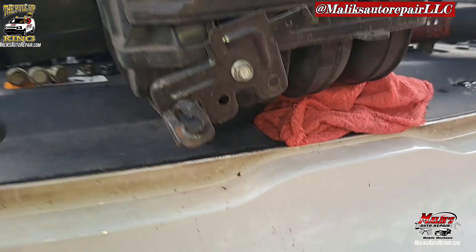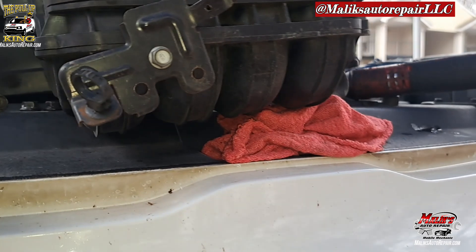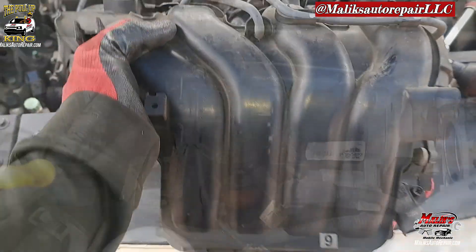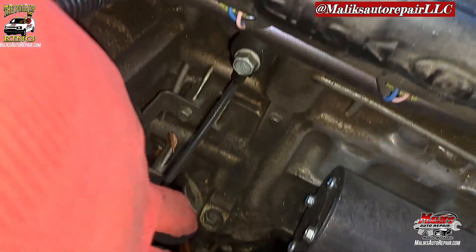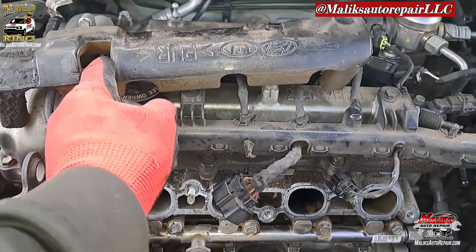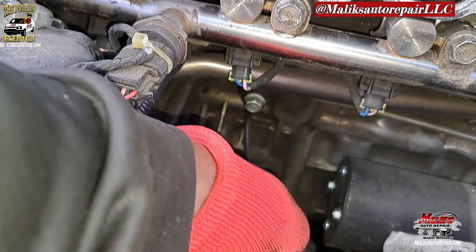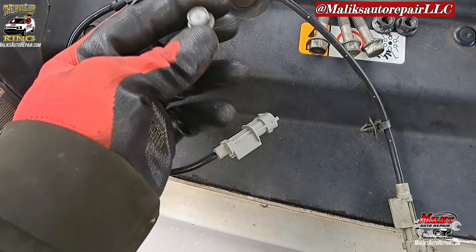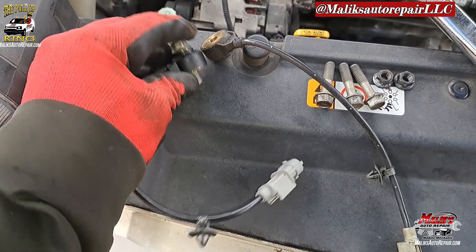And that's what we got. That knock sensor — that's the plug I had undone. That's the knock sensor. I went ahead and removed that little foam and went ahead and hit that bolt. Here we are. Now reinstall — that 12mm goes back in. We want to torque this bolt down. To what was it? 15 foot pounds.